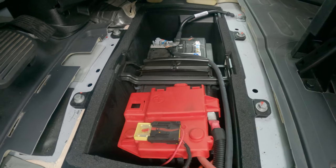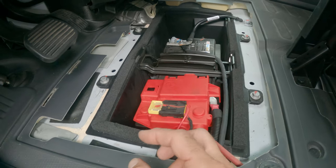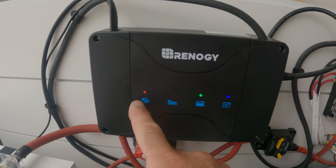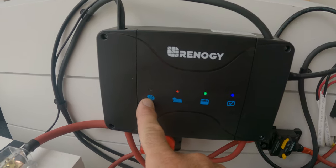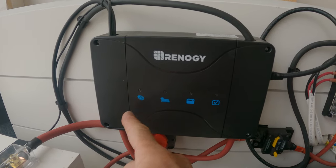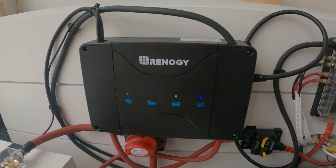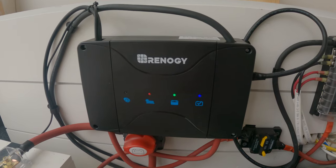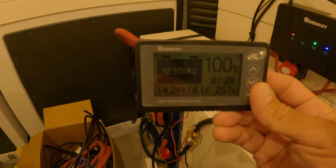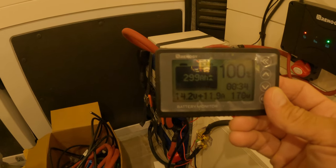Okay this is all connected. Remember if you have a smart alternator like on the newer Mercedes Sprinters you would need an additional wire running up here connecting to a fuse that only turns on when the engine's on, but since this is a regular alternator we don't need that. You can see the alternator charging indicator is now lit and working. The solar batteries are actually full now, so the solar is actually charging the vehicle battery. Tonight I can test this — if I run the batteries down a little bit I can turn the engine on and make sure it's charging the system. Just doing a test run at night — turned on the vehicle engine and you can see it's charging at 15 amps, 13 amps, so alternator charging is working.